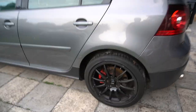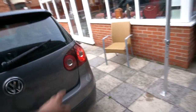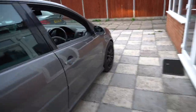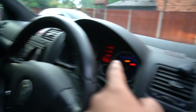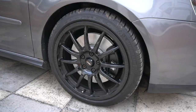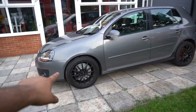It seems to be all done. There was a bit of an issue with the rear caliper bleed nipple - it was quite rounded off. The car's battery also died so I had to quickly jump start it. But looking at the front now, we have got the brake pad warning light on because of that sensor cable I damaged. But our brakes are finally coming together - I know it's got red calipers at the back but I want to leave the R logo on there.